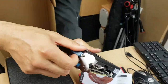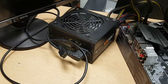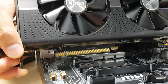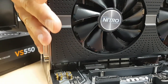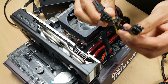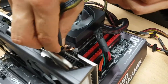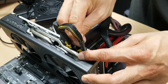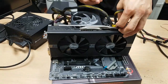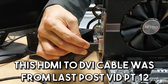Nitro Sapphire 8 gigabyte - very heavy. We've got one HDMI there. This is the PCIe slot. Don't forget to keep touching the metal to discharge yourself. Align the slot and this is why we use the board - you've got this edge which the GPU can hang off easily, no problem. Press down and click - brilliant, that's done. There's a six-pin and an eight-pin to connect. My power supply has two six-pins plus two additional pins for eight-pin, so we're fine. Connect one this way and the other the other way - it's all like Lego. Plug the HDMI cable in now.